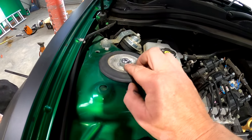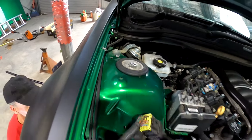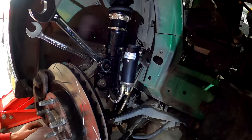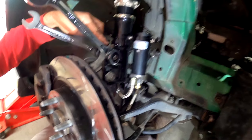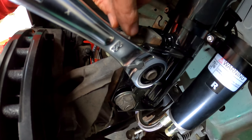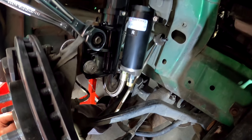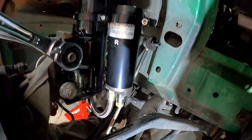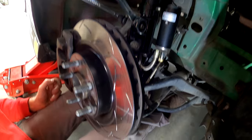We've just threaded through our new coilover, gone halfway down on those splines, and just hand-tightened it from the top. Frankie's come up from underneath doing the reverse, spanners on it, popping these back in. Make sure your knuckle is hard up against the shock absorber - otherwise you'll change your wheel alignment. With the reservoir, you've got to make sure these are directional - right-hand side, so we've got 'R' on our reservoir going to the front of the car, clear of everything.